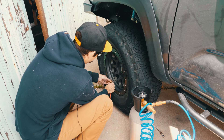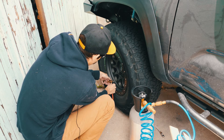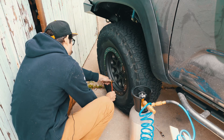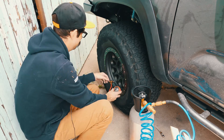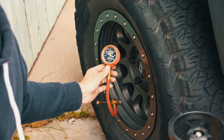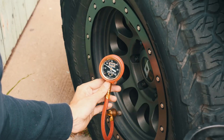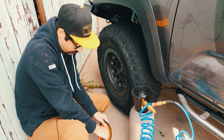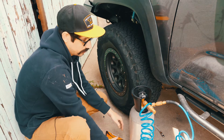Sometimes you don't necessarily need to be fast out there, but if the weather sucks and you just want to get back in the truck, it's nice to do this quickly. I'll do a little demo — probably waste some CO2, but it's all good. Let's air down; we'll go down to 20. They're at about 30 right now. Okay so there we are at about 15 PSI — I went a little bit further just to show you guys it works.